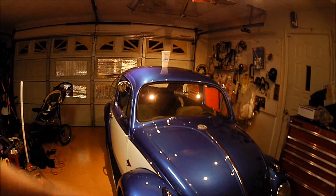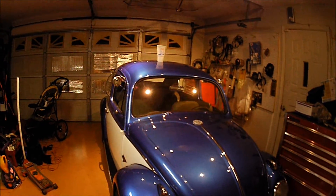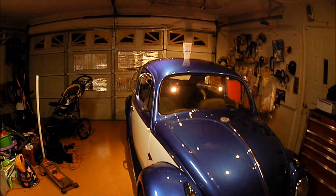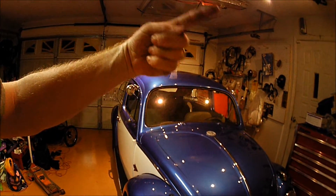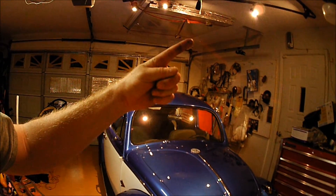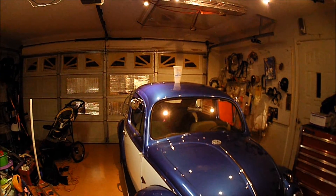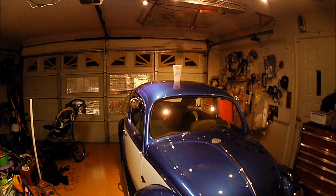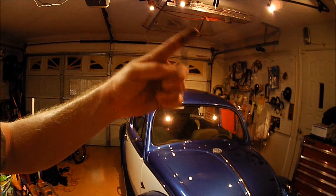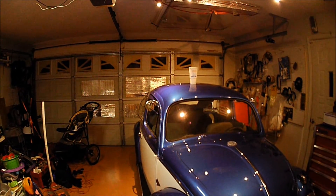If you do put adjusters in, unless you're really planning on narrowing the beam, don't super-slam it. I've seen guys put the adjuster where the grub screw ends up pointing almost straight down when adjusted all the way up — and the thing is way too low and you can't drive it. Even with the adjusters all the way up it barely moves. Be conservative — don't put the grub screw pointing straight down at the ground or you're not going to be able to drive the thing. That's exactly where John's bug is at, and it's got drop spindles on top of that — with it all the way up, it barely gets down the road.